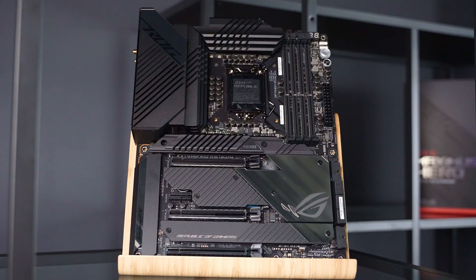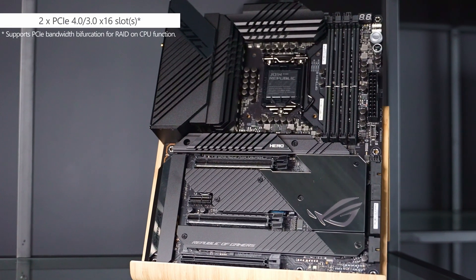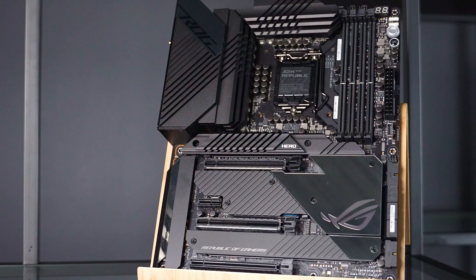Heading down the board, we finally have PCIe Gen 4 support — welcome to the future, Intel. As this is a high-end board, the top two X16 expansion slots are actually traced with PCIe Gen 4, provided you're using one of the new Intel 11th gen CPUs. While you don't have enough lanes on the CPU to run two times X16 graphics cards, you will be able to run them in SLI in 8-plus-8 mode, and with PCIe Gen 4 that would have similar bandwidth to 16-plus-16 on PCIe Gen 3.